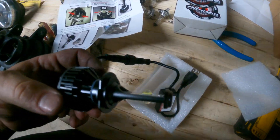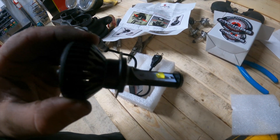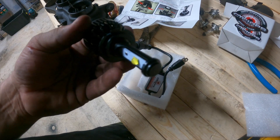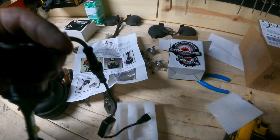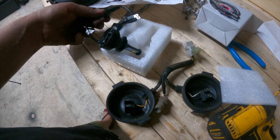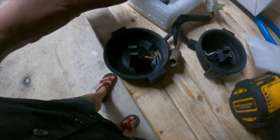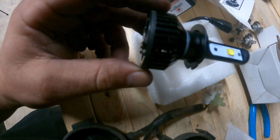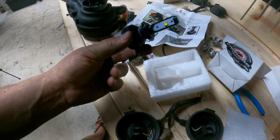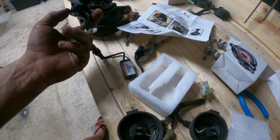These are 4,800 lumens. The good news is it's the same light bulb as a GS and GSA, so basically we have a GS now. It's labeled for DC power use. What I need to do is get this in there and see if the boot in the back will still fit. I'll probably need to run the wiring out behind the headlight housing and connect outside the boot housings. This actually has a fan in it and runs off headlight power, so we need plenty of air to it. These are 100% waterproof — just straight-up dunk them and they're fine — so I may actually leave them open to the air.